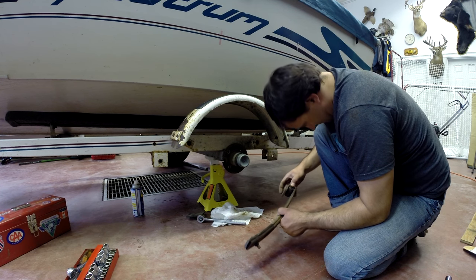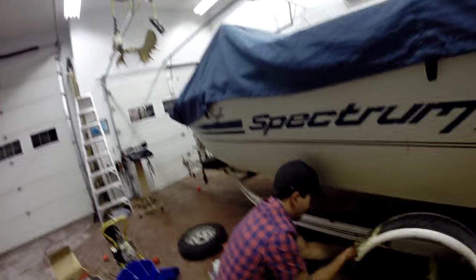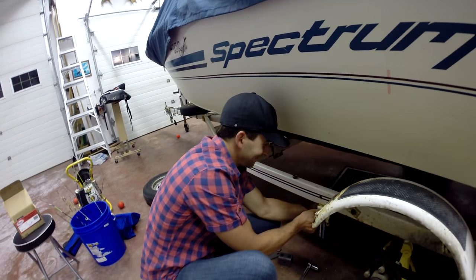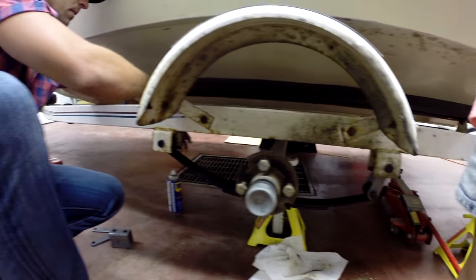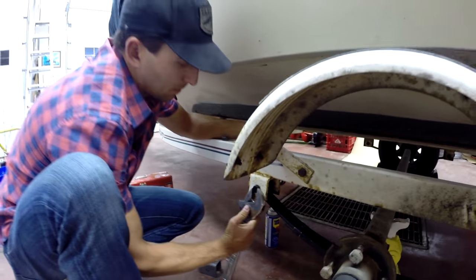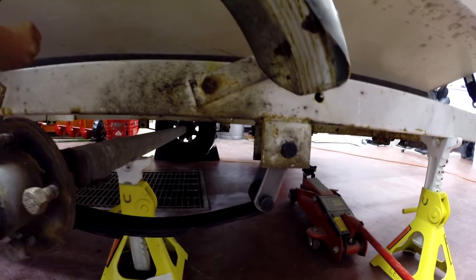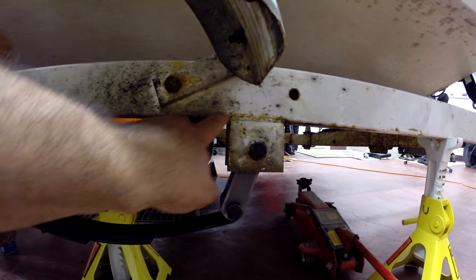So that's how you get it off. Stay tuned and hopefully I can find the right parts and put it back together later. We're back — a few hours later. Our spring length was 26 and a quarter inches, but the only one we could get in the city on a Sunday was 25 and a quarter inches from Princess Auto. So we had to buy a new hanger system. We're going to use our old brackets but just these metal hangers so we can put a shorter spring on it, and that'll have to do us for now — so we don't have to cut these brackets off and re-weld them an inch ahead.